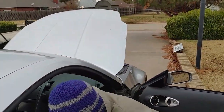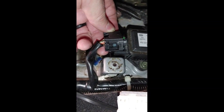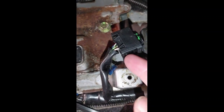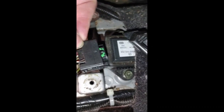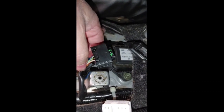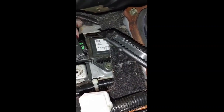This is the yaw sensor. You can see on the sides of it are these pins you have to squeeze in. I had to stick a screwdriver through here to push on this side while I pinched with my fingers on the other side, to gently wiggle it back and forth to get it out. Now I'm having to slice this insulator so that I can cut this red and white wire to install my Magic Burnout drift switch.